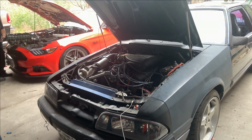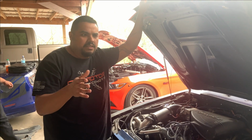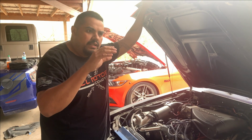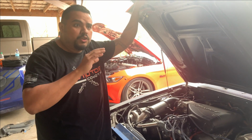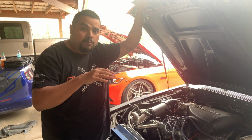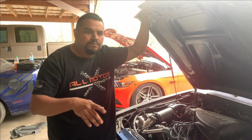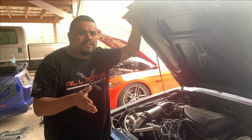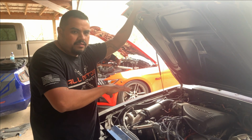Yeah, that's true. Yeah. So, I'm not sure how many videos David is posting up, but you can see the process where the car barely idles, and then you're cranking. It wants to turn on, but it doesn't. So you let the wideband settle for a little bit. Check what the fueling is. It went full lean in our case. Made adjustments, added more fuel. Still did somewhat the similar thing. Then it finally idled, but it barely registered 17 and then full lean. We made another adjustment. Now we're on the money. Yeah. So it's a process on these things.